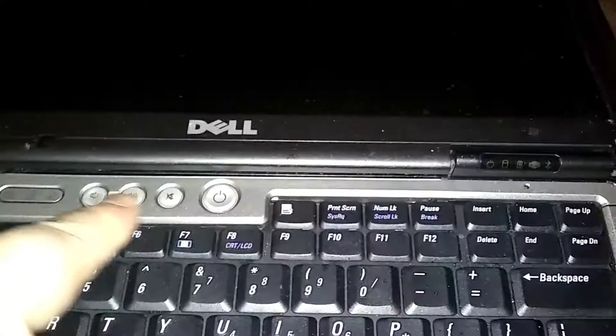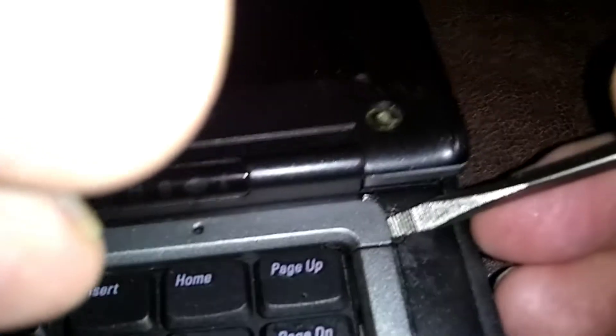Now we're going to open it. I'm trying to do this with one hand so I can get in tighter with the camera. Lay your display down flat. Come with a straight edge screwdriver. We're going to lift this bezel off here in the back — that's where the power buttons are. We're going to go over here in the corner. You'll see there's a little notch right here for a screwdriver. Go underneath here and finesse it off real slow.